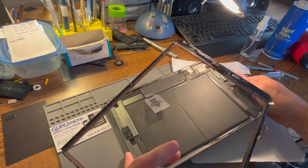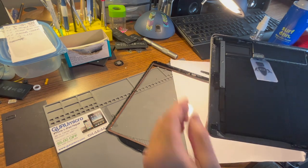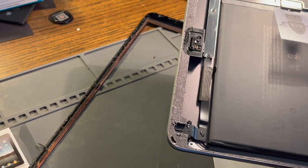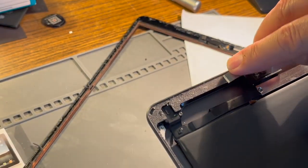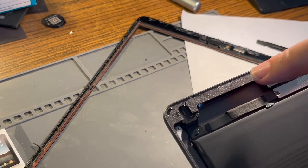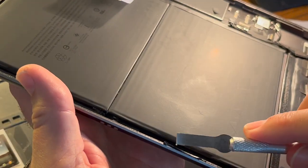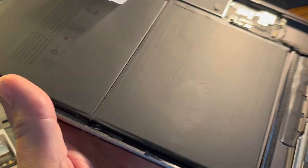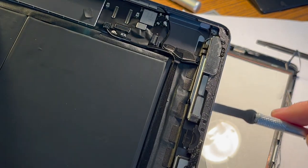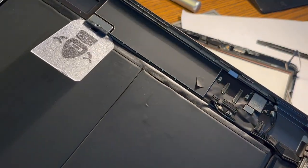This still needs a lot of work — this is not even the end of this. You can see all of this sticky glue, all of that sticky adhesive. I'm going to end up going around with this tool, this exacto, and I'm going to clean every bit of that off until we're down to shiny, clean, bare metal. You can't have any pieces of adhesive stuck on here — the new screen won't seat. All that has to come off or the new glass will not adhere properly and it'll come loose.